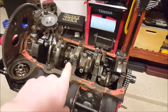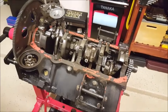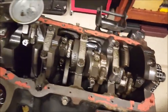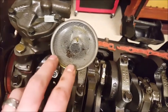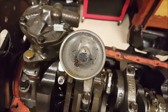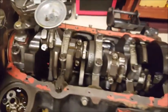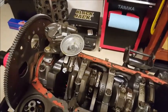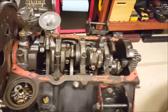Got the oil pan off, pulled the gaskets off already. Still got to go around and clean this up — same process as everything else. Use the same tools, just be careful not to let any big chunks fall down in here; wipe it all down and vacuum it up. Took a look at everything and it looks great. Got a couple chunks in the oil pickup, but it looks really good. I've got to put on my other oil pickup since I have a bigger pan now.